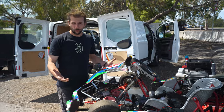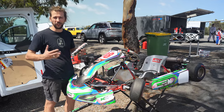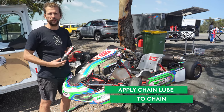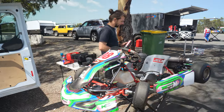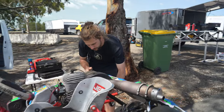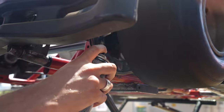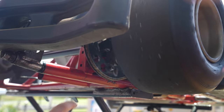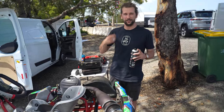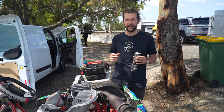And that's basically how you rev up the brakes, warm them up, and warm the engine. The next thing — probably a good idea before you started the engine — is to put some chain lube on the chain. Go to the rear of the kart, spin the axle, and spray around the chain and sprocket area for around three or four seconds. That gives the chain enough lube that during your session it starts to disperse, keeping the chain wearing nicely and lasting longer.